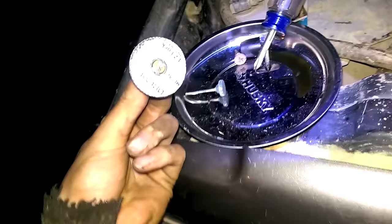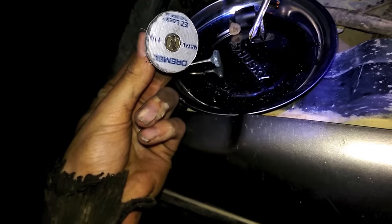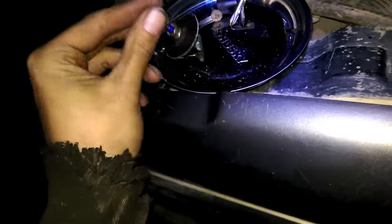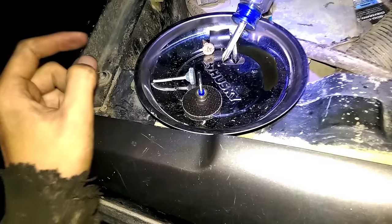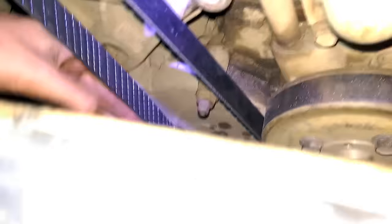Get a grinder — this will take down the metal real fast because it's light aluminum, and if you want to polish it smooth, use a little grinding stone. It's a pain to get down there and grind, but it is clearing. I'm comfortable running that now — it's much better than it was and the belt is nice and tight. Cherokees like tight belts.